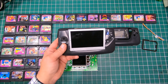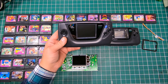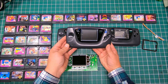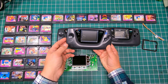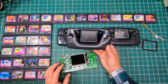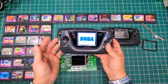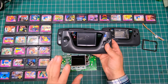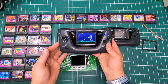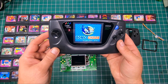I'm sorry, that's not it — that's another project I haven't finished yet. It's actually right here, sorry about that. On first glance it looks almost identical to a stock version, but I did some modifications. Basically I installed a McWill screen — it's a TFT 3.5" backlit screen, which is really, really nice. There's no comparison with the original one; this is a real jaw-dropper quality-wise. I 100% recommend it if you're planning to modify your Game Gear with a McWill screen.